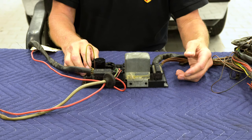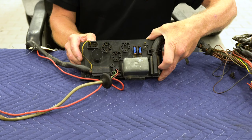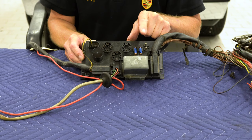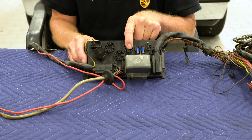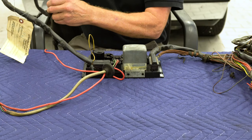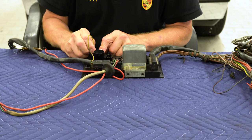For you 1.8 owners — '74–'75 relief — look at how much less complicated this relay board is. That's because the 1.8 has the superior, more modern fuel injection system and doesn't need as many connections. We have the same alternator, the same voltage regulator, the same front. This fuse only works the rear window defroster now. The fuel pump circuit is out of the picture and the auxiliary air valve is out of the picture. No relays here except the optional rear window defroster, and the later the cars went, the fewer had that option. The ignition harness right here — the 1.8 ignition harness had the fuel pump relay on the other side of it and the yellow lead, which provided power to the fuel injection system in the starting mode. That's why it has this plug in the right rear. That's how simple the 1.8 is.